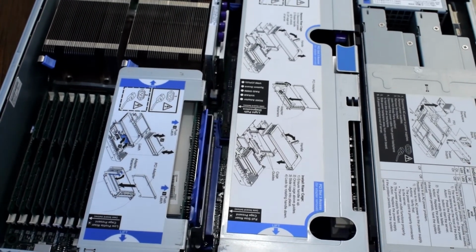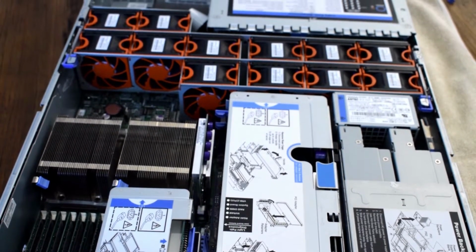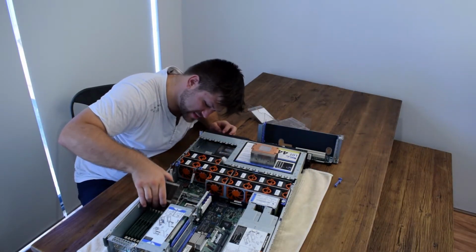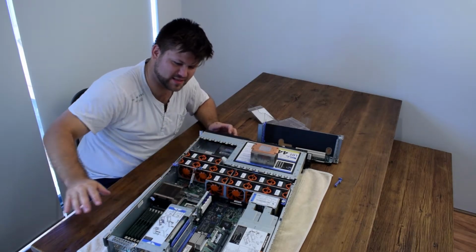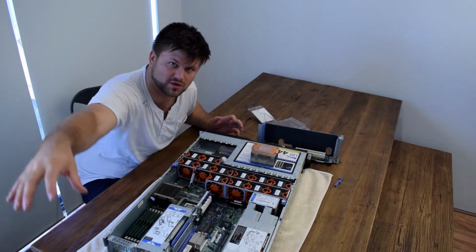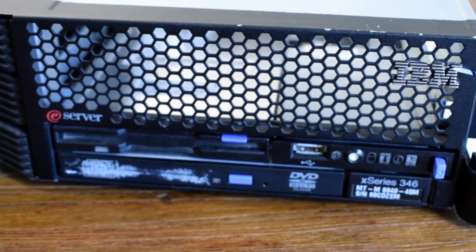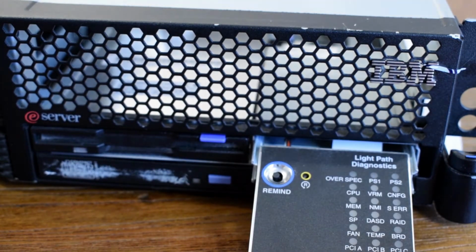As you can see, this is not a standard setup. It does not have a fan on the CPU, just cooling rails, I suppose, just aluminium metal, maybe even on the bottom we've got copper. But that's all there is on this because it's passively cooled in the sense that the air passes through the system and out. There are huge cooling units in the rack areas where the cold air gets pushed in and basically pulled out. I believe the hot air goes out the front, and the cold is always behind it, so it's sucking it in. I've been to a data center before, and that's pretty much what it looked like. You have little cold rooms where the fronts of it are, and then out the back is where all the hot air leaves.